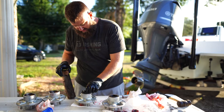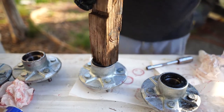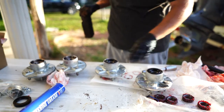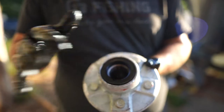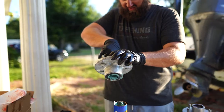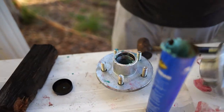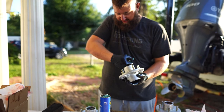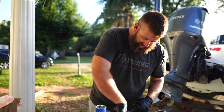We're going to do that on the remaining hubs the same way — bearings in, sitting nicely into the bearing race. I'm also going to pack some grease on the rear bearing because these axles do not have a fitting to get grease to the back. So I'm going to take a little bit out of the tube and apply it to the rear bearing on these axles. It makes me feel better, even though I'll get plenty of grease in there through the buddy bearing.